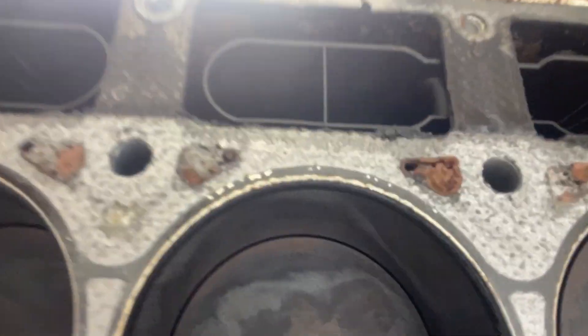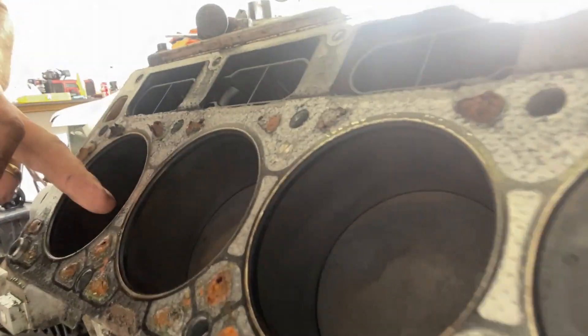I can see some coolant just dropped in there when I took the heads off, a bit of mud and stuff. There's no head gasket issues I can see — I can't see any compression problems. I didn't check the compression when I took it off, but it did look like there was some oil just leaking out in a few spots, so we'll rip them off now.